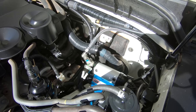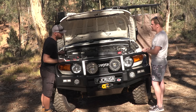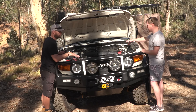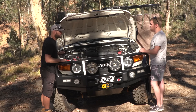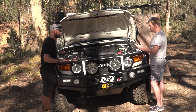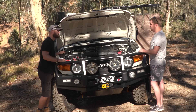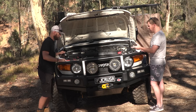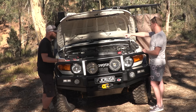There's an ARB compressor up here. That's the breather for the winch. The Ironman 12,000-pound winches are IP65 — completely sealed, and they come with a breather. One of the guys in my club, Gav, has a huge heavy 100 Series Cruiser and he flogged his Ironman winch, then put it on his comp truck and it's still going. So I bought it after mates with big heavy cars who do a lot of four-wheel driving have had no problems. I did have a cheaper winch before. Your electrics are actually pretty neat. Yeah, it's real basic — if I have a problem I can check the fuses, check the line, check the earth. With electrics, simple is good.